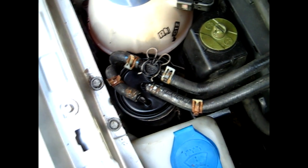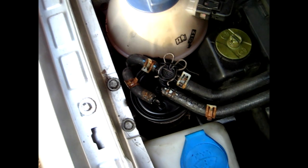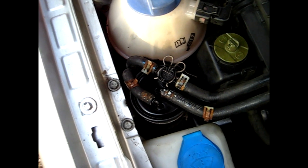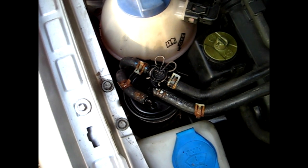Start the engine up and let it run for a second until it starts to smoke, then turn it off and let it sit for about 15 to 20 minutes to soak in the engine. Then start your engine back up and let it run. After you let the car sit for some time to let the Seafoam soak into the motor, you can start it back up and just let it run for a little while until it's out of the system.